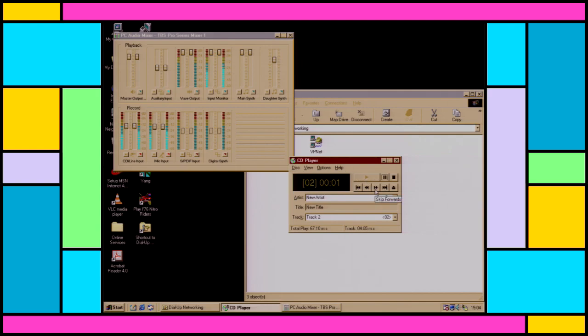For example, I had the Soundblaster 16 as the preferred output for sound in Windows, so it was the default mixer you'd get if starting Windows volume control. The problem being that the Turtle Beach software removes this from the registry every time the system boots to replace it with their own, so you would have to use a shortcut placed elsewhere to get in and change volume levels on the Soundblaster 16.